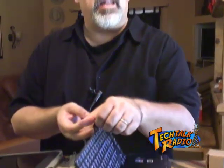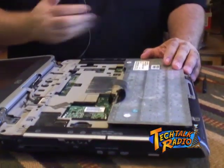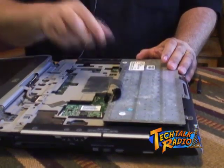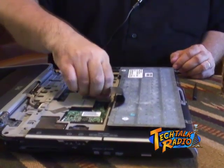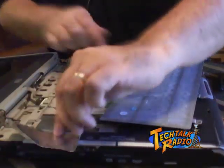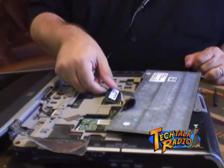Before you take the keyboard off, you want to remember to lift it gently, because it's not like that first piece we pulled off — it is attached via a ribbon cable. If you break this ribbon cable, you're going to have to get a new keyboard, and this cable is attached to the motherboard right under this unit. We'll kind of put that aside without disconnecting it completely. The memory is under this protective piece right here. Getting to it is fairly easy — put this piece aside, you'll want to reuse it. Just take your fingers, like you did on the other one, and flip it open. It'll pop out at a 45-degree angle.